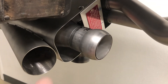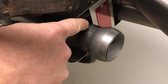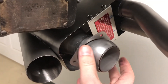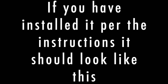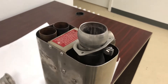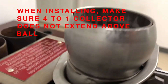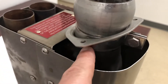Once it's in position after we've trimmed it, you would drill a hole through there — it doesn't really matter where, just wherever it makes sense so you can get to the clamp. Then you would take it off, put the flange on, put it back to wherever you've drilled it. This is what the intermediate tube looks like. This is the ball joint, and you can see the four-to-one — we want to make sure that the ball is at or above the surface of the inner four-to-one, and you can see it is. If it's not, you have to trim the four-to-one.